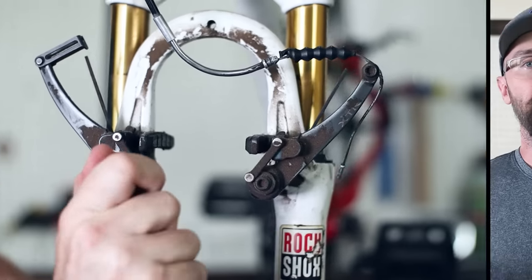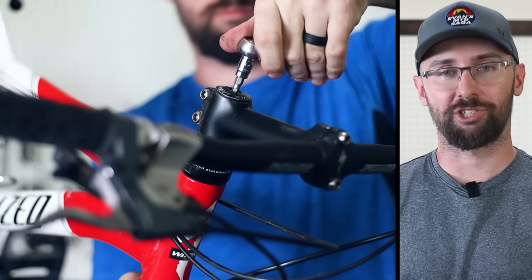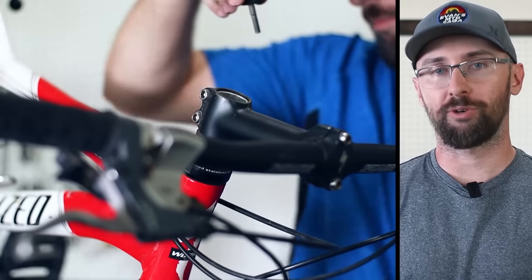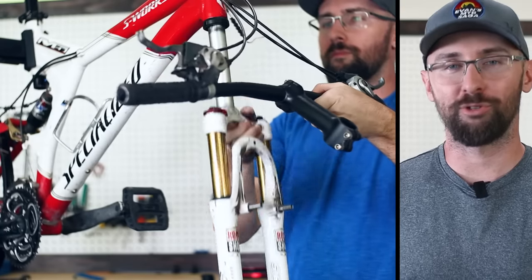This thing is light. Hearing that this bike has been sitting around for 10 years, I don't dare even compress the shocks because the seals could be corroded and there could be no oil in the shocks. So before I even roll around on the street, I'm going to rebuild both shocks.